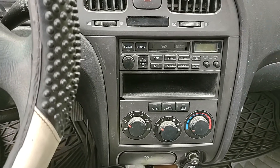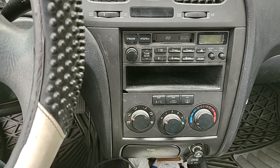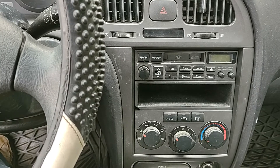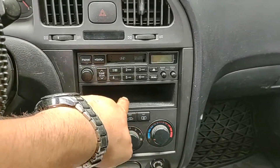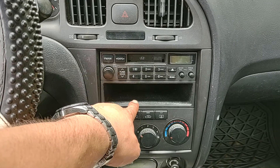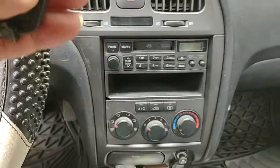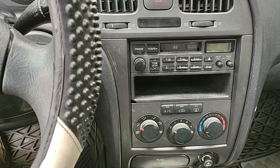I have in stock an old module and a remote that have been sitting here for at least a couple years, so I'm going to replace it and use the remote that came with that other car. If you go to a junkyard and get that module — which is the security alarm and basically the body control module — you can replace it with the remote that came with it. This way you don't have to program anything, just plug-in and play.